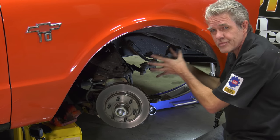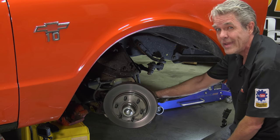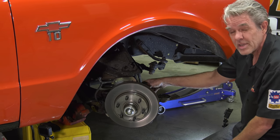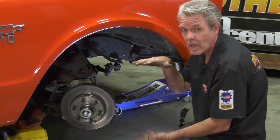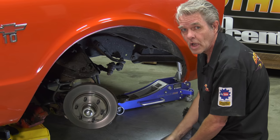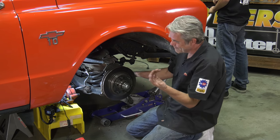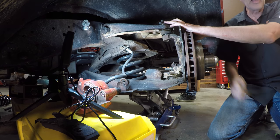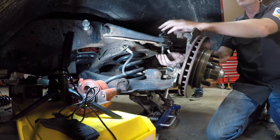Side note: this is semi-potentially dangerous — watch your fingers. If you were to take these bolts off all the way and then popped it, it'll come springing apart. We're lucky this has drop springs so it's not under a lot of tension. But if this had stock springs, there would be a lot of tension and when it popped it would explode apart and take out fingers. Make sure you have those nuts on there. I'm going to try to disconnect just the top and let the spindle fall forward to save some time.